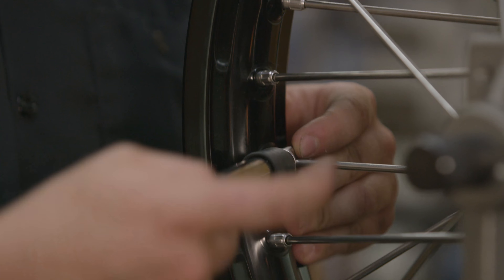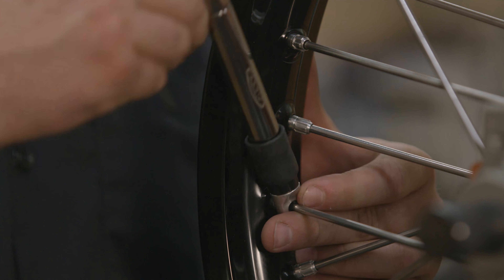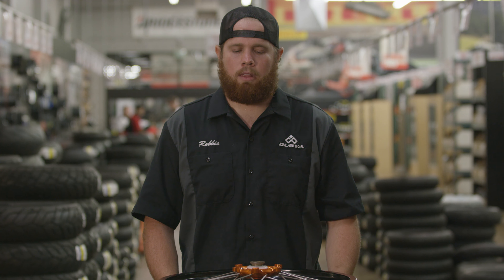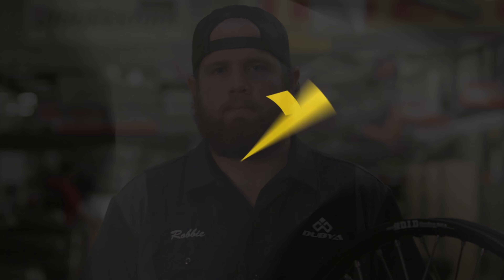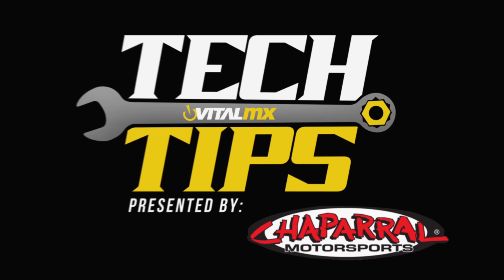As far as how often you want to maintain your wheels, the wheels are going to do their most moving and stretching when they're new. You have various factors at play — the spoke head setting into the hub, the nipple setting into the rim, and the spokes having their initial stretching period. When you start with a new bike, I'd recommend checking every hour of riding, just because they're going to be loosening up more than usual during that initial break-in period. From there, taper it off and check it once a week. Get into the practice of making this part of your bike prep — you change your air filter, you check your wheels. One of the most common causes of catastrophic wheel failure is improper spoke maintenance, so maintain your wheel right so it'll last you the longest.